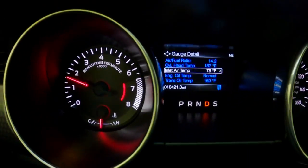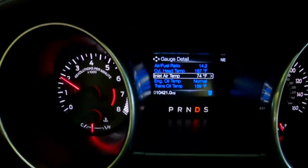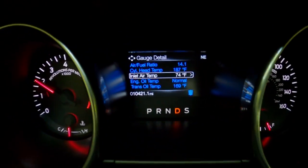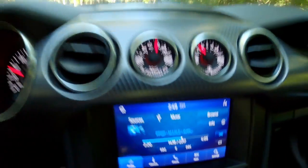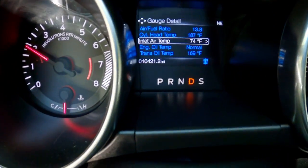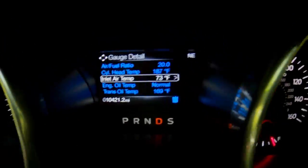With just a little throttle you can see it jumped down to 83, so we're still in range of where it was before. Cruising around moving, it would stay within about 10 degrees of ambient. I've been driving around just a little bit — normal driving, nothing crazy — and yeah, the temps are consistently lower than before. It's a slight improvement. Right now according to the car the ambient temperature has gone down to 71 degrees outside. Our intake temp right here is 74 just cruising, and if I roll into it, it drops down to 72 — getting really close to ambient, and it happens quickly.